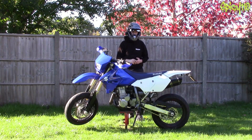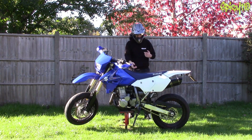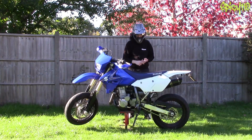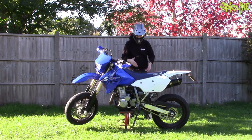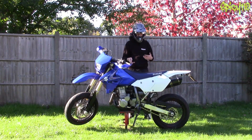If there's excessive movement in them, it will be an MOT failure. However, depending on where it is, not particularly expensive or difficult to do if you can do it yourself, but pressing them in and out of the swing arm and having to take the swing arm off to do it could be above some people's abilities, but the point is it's something you have to periodically check.